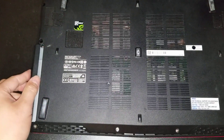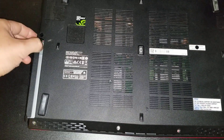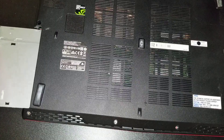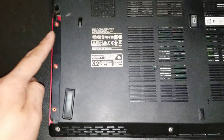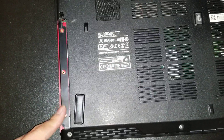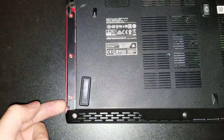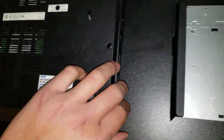After that you can pull the CD tray out. Just get your fingernail between here and pull it. If it's stuck, just wobble it a little while you're pulling and it'll come out. After you remove the 15 screws, there's 3 more underneath the CD drive.